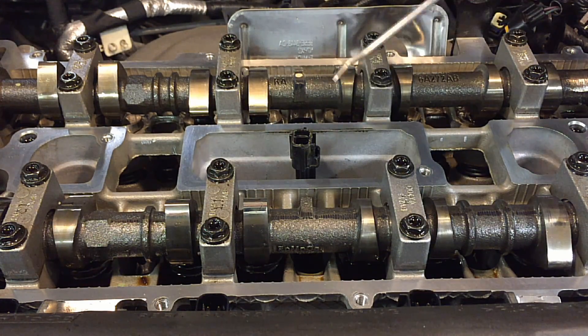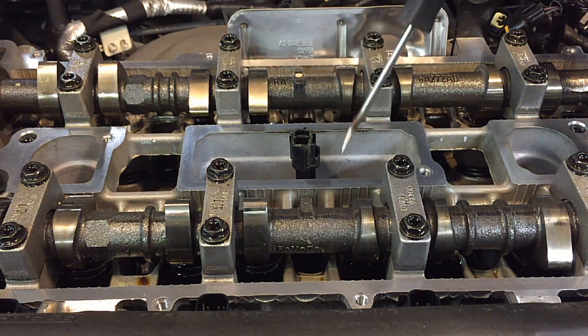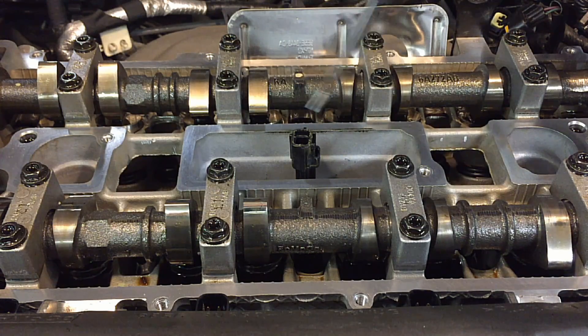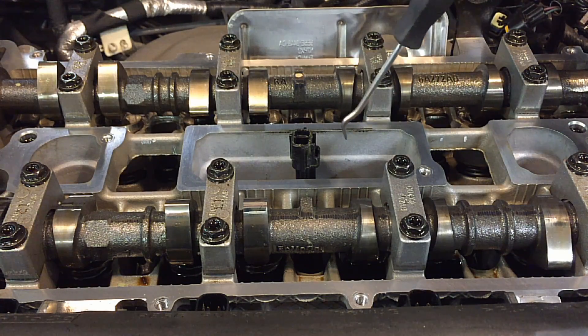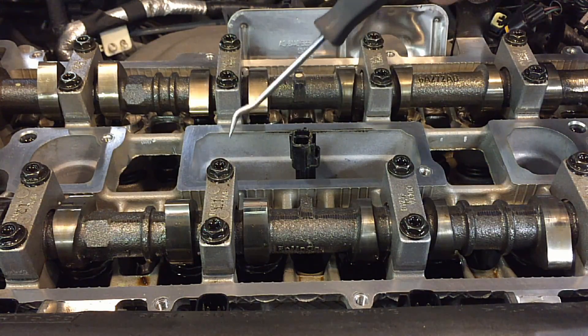On the six-cylinders, like the 3.0 and similar, they'll have round ports in the valve cover that go straight down — those have O-rings. Same thing on the inside valve cover that seals the port. It's not usually a casting flaw or a crack in the head — it's almost always that gasket. I'll show you how that gasket looks in the valve cover in a second.